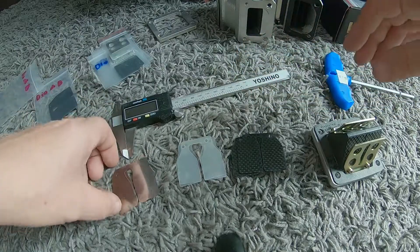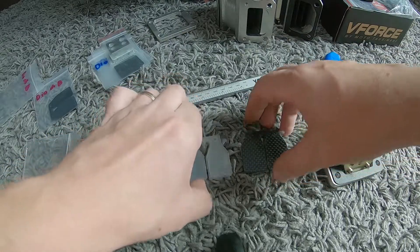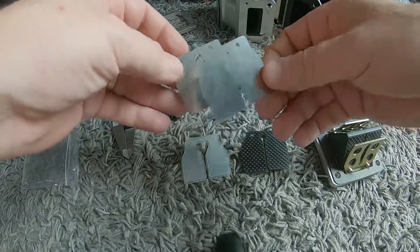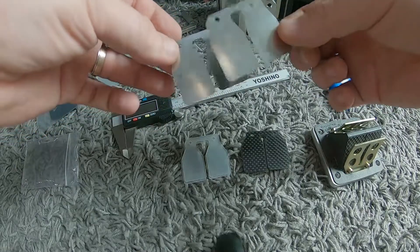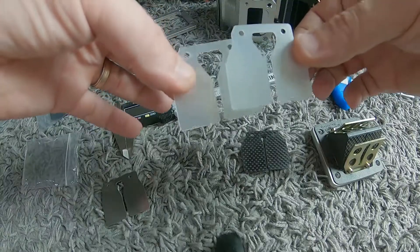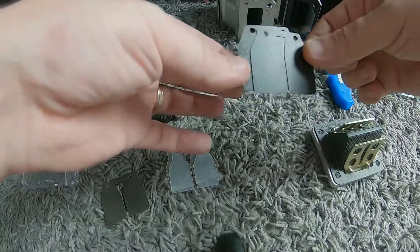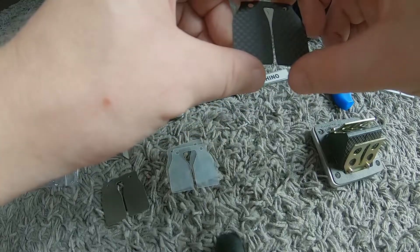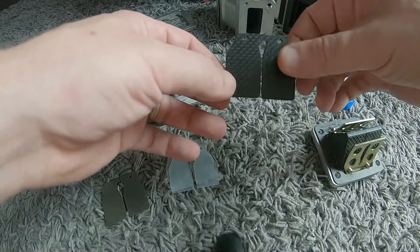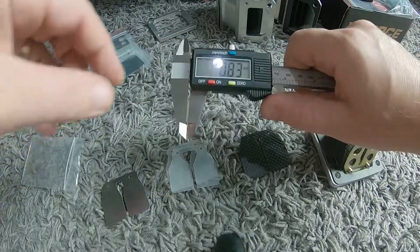As you can see, we have three different selections of reeds available for the big black manifold from TWH. We've got some metal reeds here — I've never tried these before, so I'm not really sure how good they are. Then the standard fiberglass reeds, and the upgraded carbon fiber reeds. These come from a local guy who makes them to order — you just send him the specifications and dimensions, and he'll cut a big sheet. So I've had a few of these made up. Let's look at the thickness with a digital caliper.